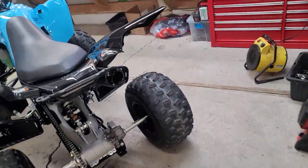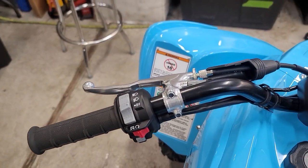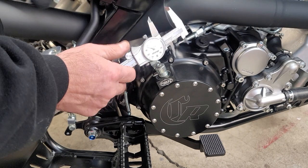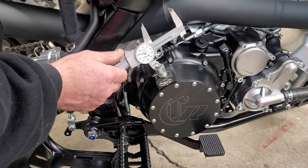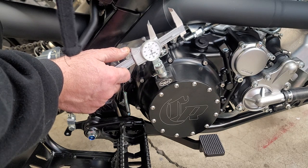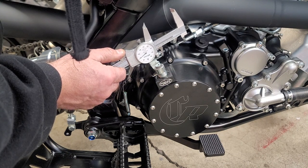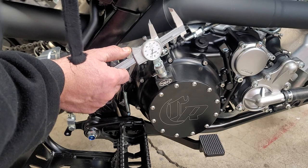Now on to this bike - same deal, same lockup on this bike - different levers, stock grips, our sport lever with stock style grips. Let's do this again and see where we're at. Okay, we're starting at zero - one, two, three, four - so 500. Run it again just to be sure, pulling the slack - now we're actually starting more toward 20 - one, two, three, four - so 500.